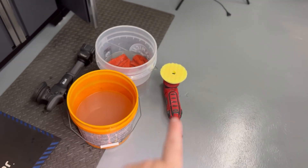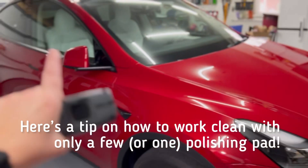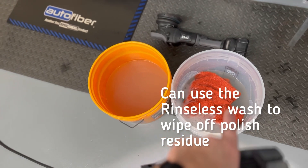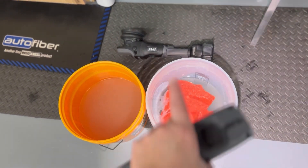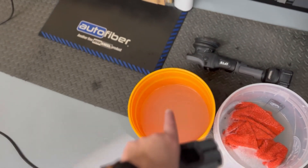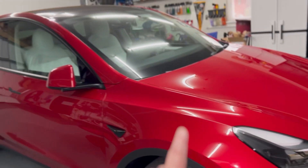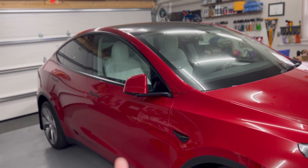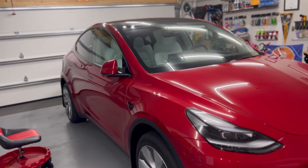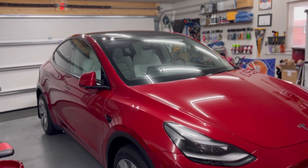I only have one pad that they sent me — Ivan and Nick, can you send me a few more? Because I'm really loving this. But I'm not going to freak out about just having one pad for this entire vehicle, because we actually have two buckets here with their rinseless wash. I'm going to use this one to wipe off my polish residue, then follow up with a drying towel to help remove the polish residue safely and leave behind a squeaky clean surface. I also have rinseless wash in this bucket to wash the pad after every panel, so I can clean out the polish residue and any clear coat, making sure it is clean, damp, and primed and ready for me to work effortlessly around this vehicle. So you don't need five to twelve pads — you can use one as long as you are cleaning it properly.